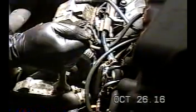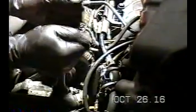And that'll be nice, because once we get this thing off, then we can start working on the bolts to the valve cover. The good news is there's only one of these water pump pulleys, and there is no pulley to remove on the back bank. The back bank's not going to be very easy to remove the valve cover, but at least we don't have to deal with removing a pulley. We'll get to that later. Anyway, we're almost done pulling this off. Certainly getting easier to turn.